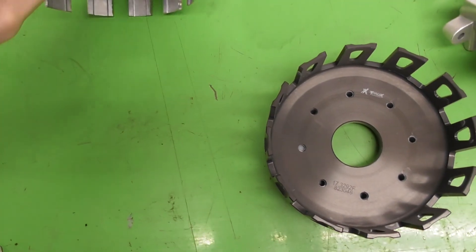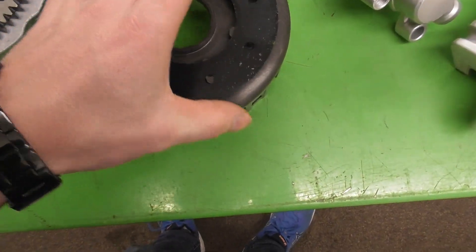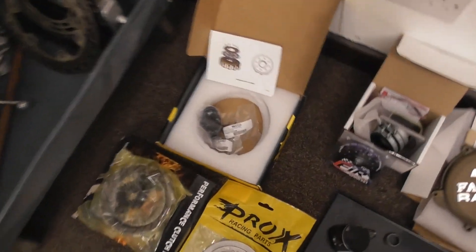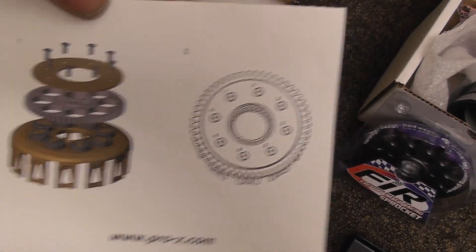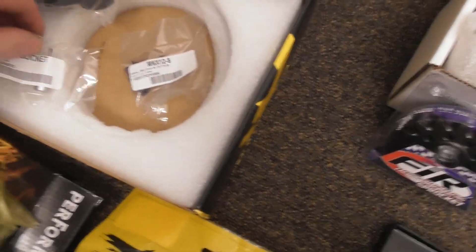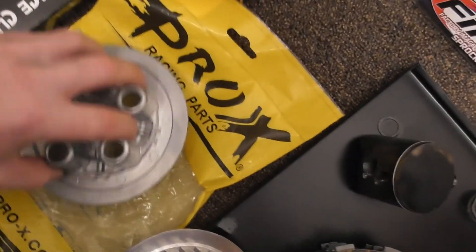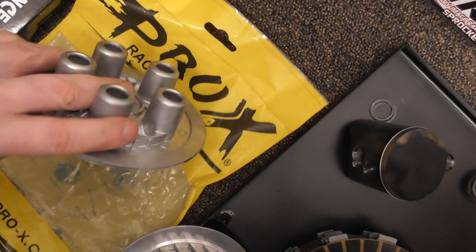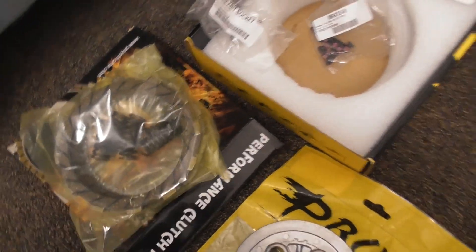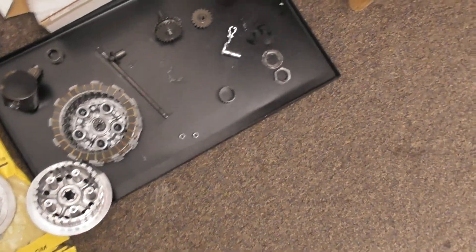So what we have to do with this is drill the rivets out, and then pretty much take this backing plate off, and then fit everything back over. It comes with nice fitting instructions - as I just said, you drill off the old ones and then it comes with the new rubbers. There's a socket for putting the new screws in to hold the clutch back on. We've got a Prox Racing outer clutch, pressure plate, Sidekick Racing clutch, Factory Image Racing lightened front sprocket. There are the old parts there.